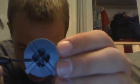Then you're going to stick your screwdriver down into the opposite side from the screws, and you find a little clip. I'm going to show you that again, and it's not that hard to take apart. You can see in there, on the part where I didn't unscrew them, there are these little black clips right here. You're just going to press your screwdriver down into that and press that clip down, just one side really, and your D-pad's going to come out like that. So you place that by the buttons part, and so now you have your front shell and your back shell, and then you have your bumpers.